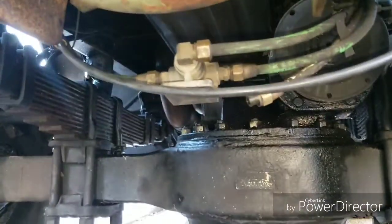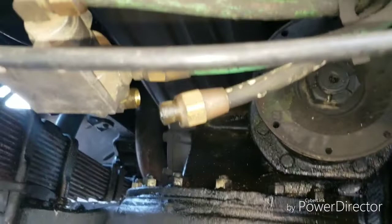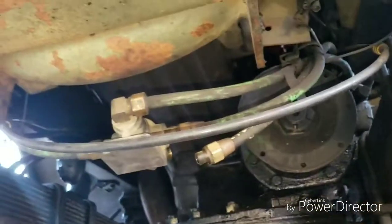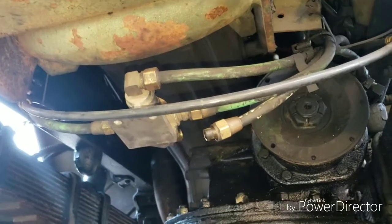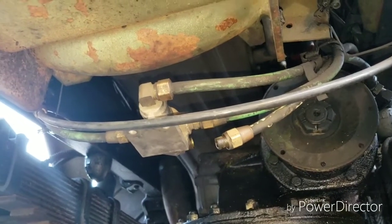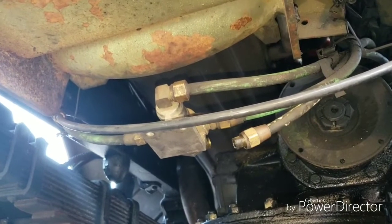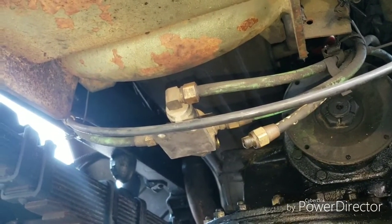Here's what the Q2 valve looks like — it's actually a plate that mounts right here onto the suspension, though mine has an engine mount in the way. The way to tell it's a Q2 valve very easily is to remove the vent line off the Q2 valve. Then go up in the truck and hit your brakes. If the air does not dump back through the intake, you'll hear it dump out the front of the truck real loud. It'll be a real bad hiss from the front of the truck.